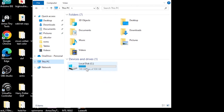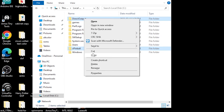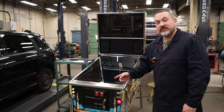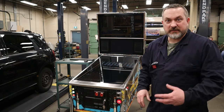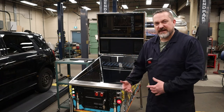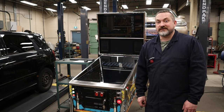As a very simple option for people making a minor change to one folder who just want that backed up: go to File Explorer, go to This PC, C drive, and if you Control+click on VPinball and DirectOutput you can right-click copy that, then paste it wherever you'd like — your desktop or an external USB. That way worst case if anything happens you still have all the files exactly as they need to be, and you just right-click and replace over the copied folders. That's a wrap on another video from Way of the Wrench on how to clone your hard drives so you can back up your information and do all your updates without messing anything up.